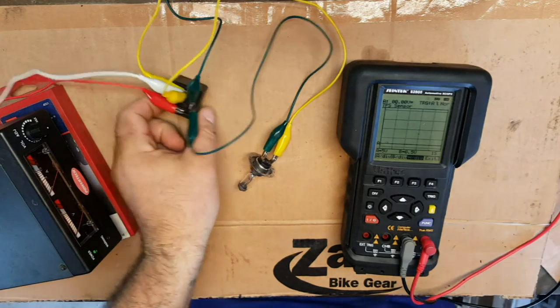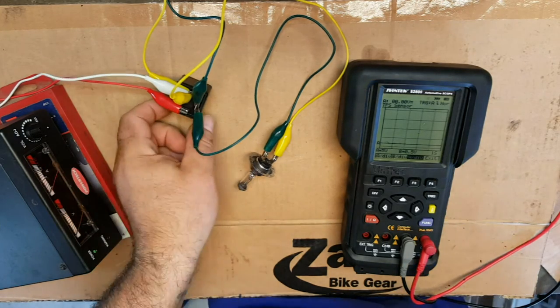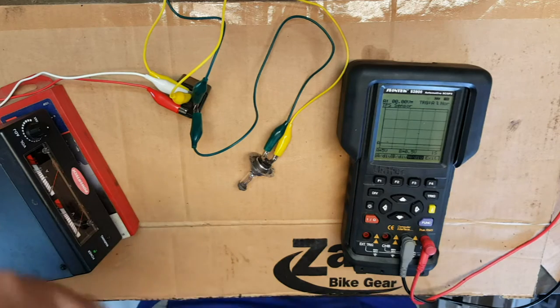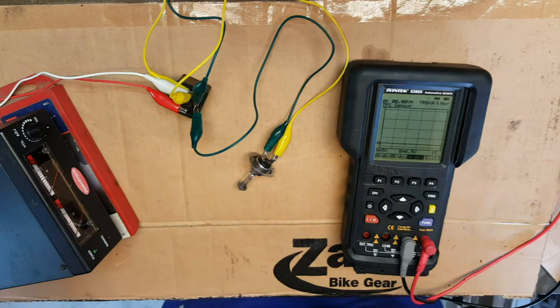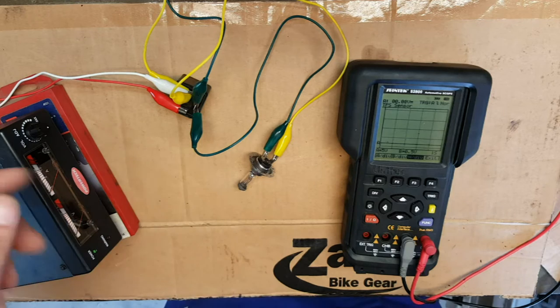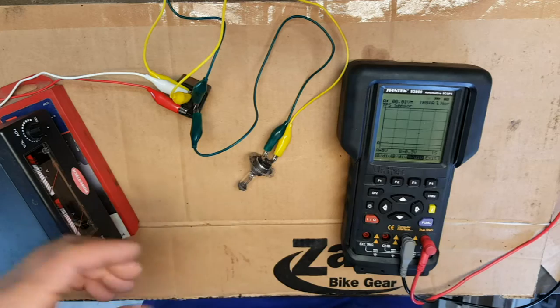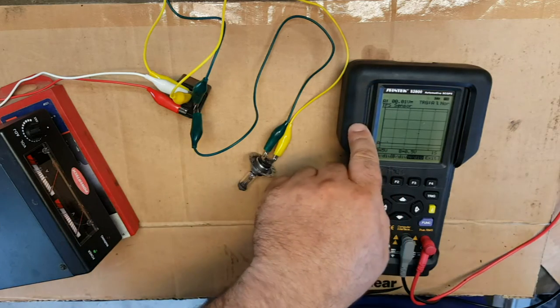Okay, so I've just rigged up a real simple flasher relay. Now, this isn't an electronic flasher relay. This is one of the old school mechanical ones, and you'll hear it actuating once it fires up. Now, at the moment, we've got current flowing to it, but it's insufficient to operate the armature inside. We're essentially around about 0 volts. There's hardly any current flow. In fact, we're 0.01 volts.